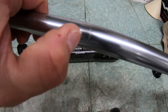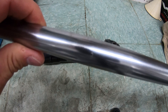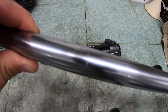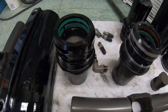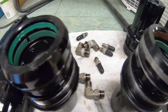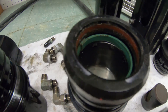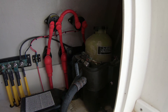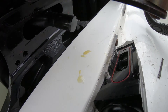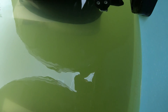Ultimately it will catch the seal on the cap and destroy it. It's 100 bucks for some end caps and seals, or an 800 dollar ram — if you can sand it out and get another season, go for it. On these Verado cylinders though, that isn't the issue. The issue is that on the inside the rubber seals deteriorate and begin to leak, and then due to the high pressure of the power steering system it will push fluid out of the cylinder.